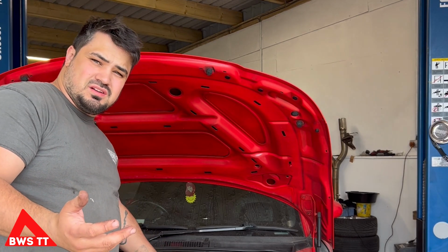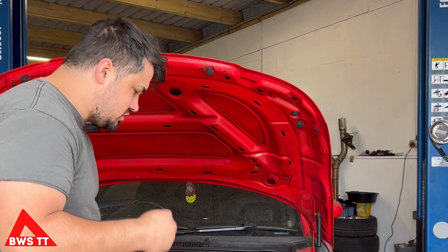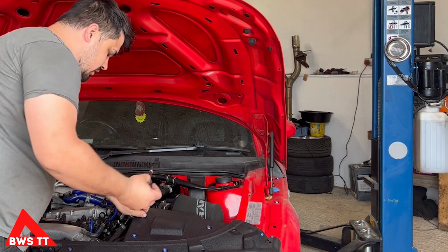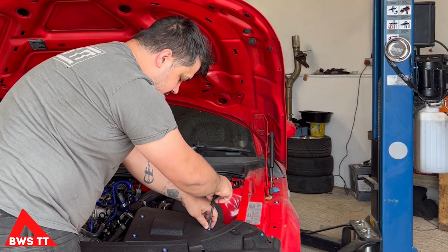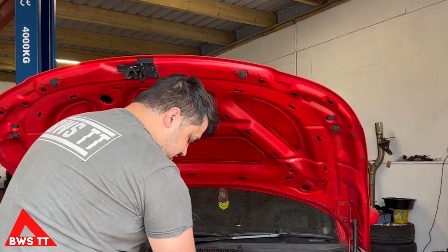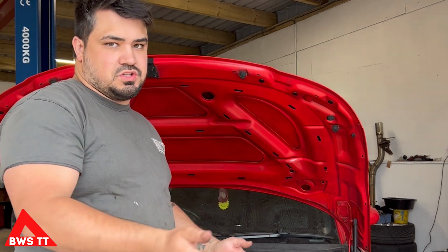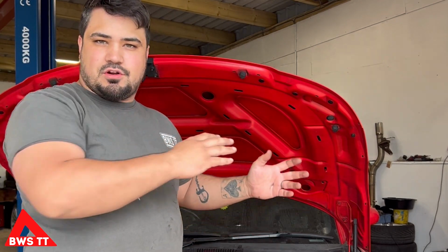So basically anywhere that can sell your battery can usually test your current battery to see if that is your problem. But if you're having slow to start or if it's constantly going flat, then you're going to need to change it. This one, I've had it on charge a few times and it's been all right, but it's just got to that point where if it's left for any more than a day, the battery's just completely rubbish. I just had this running for an hour, turned it off, it started up once, turned it back off and it wouldn't start again. So this battery is no good. I've confirmed that the alternator is doing its job because it carried on running for an hour, so it wouldn't be able to do that if the alternator wasn't charging and wasn't putting current into the system.